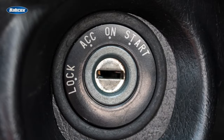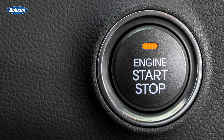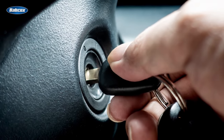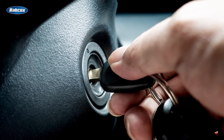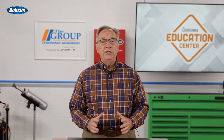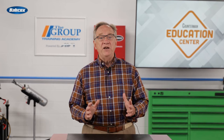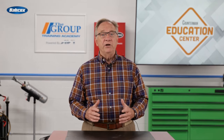It all starts today with an ignition switch. This may be a key activated switch or a more modern push button style. Interestingly enough, cars used to have push buttons before the advent of the keyed switch. Whichever is used, the result is current being sent to initiate the starting process. This switch could not possibly carry the current required to turn the engine over, so another switch or relay is placed in the system to carry the heavy current.